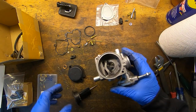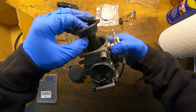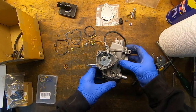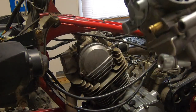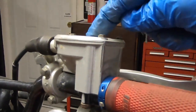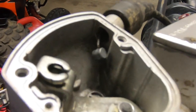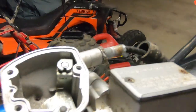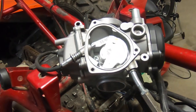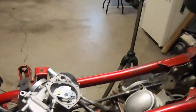I don't know - we'll try it, and if it doesn't work out I'll buy a new carb. Let's put this back together. Back at the bike, let's try popping this thing on. I had a little bit of issues with the throttle cable hookup - got the throttle cable hooked up with the pin and everything. Had to bring this nut out quite a bit - it was all the way in and there was a lot of free play in it. That's not too bad right there. We'll start with that - I'll leave the cover off because I may need to adjust it.